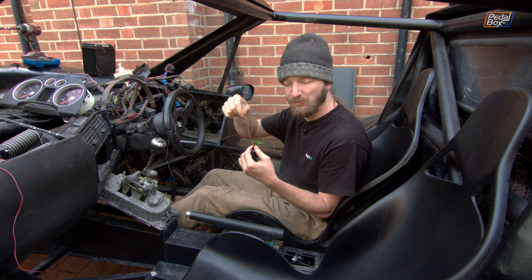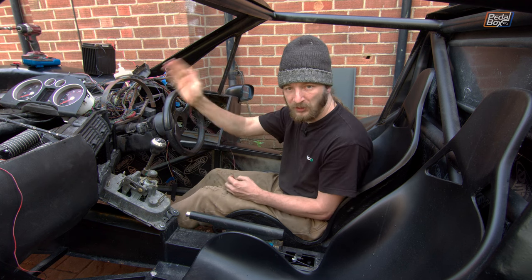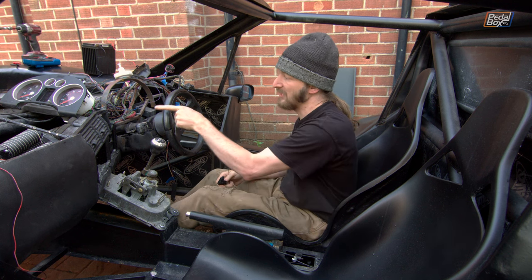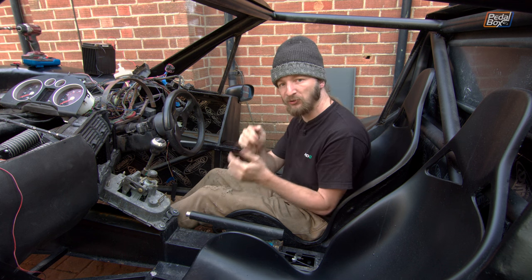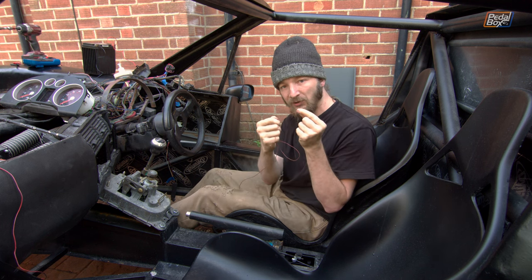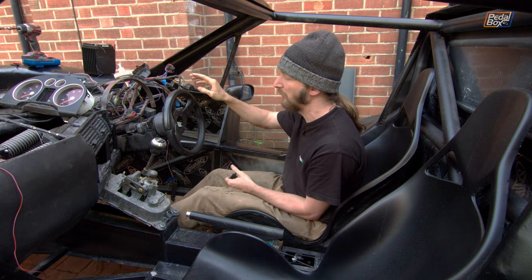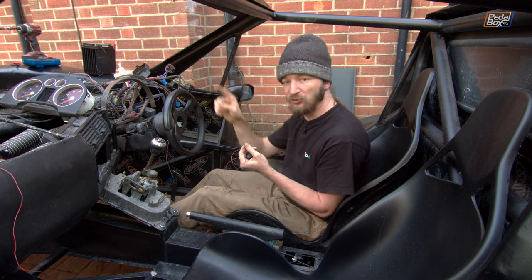Out of the switch, we've got a brown cable with a red stripe that goes to the instrument cluster for the indicator light. So we thought: OK, if it's a brown and red cable on the green connector on the instrument cluster, we'll follow it from the green connector back, cut it, and splice into it. We did that and it didn't work. It turns out that the brown and red cable coming out of that connector is actually wired to a completely different pin, totally unrelated to the handbrake switch. When we looked up the correct pin and pulled the connector housing apart, it turns out that somewhere in the wiring harness this cable - brown with red - becomes brown with red with yellow dots on it. That cable is the one going into the right pin on the connector. It took us quite a while to figure out what was going on because we just doubted our own sanity. We did eventually find it, so now we're going to splice the brown and red cable into the brown, red and yellow and see if our indicator works on the dash.